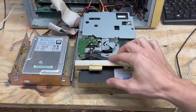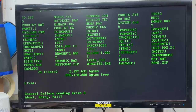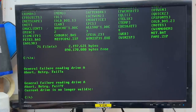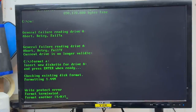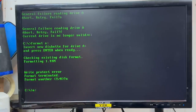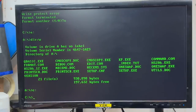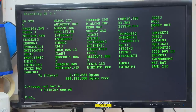Let's get a disk in that 5¼-inch drive. Since the terminating resistor block is in that drive, I'm assuming it's A drive. It's doing stuff — doesn't look happy. General failure. Try once more — nope, got to fail. Let's try formatting it. Write protected? That disk's not write protected. Let me try another disk. That was a double density disk, so let's try a high density disk. There we go — yeah, it's working. Let's try copying something to it — net.bat might be kind of small. It works! I guess that drive's good.